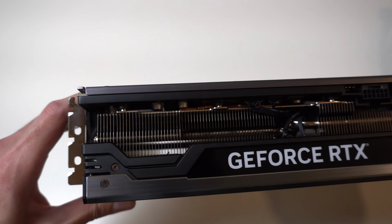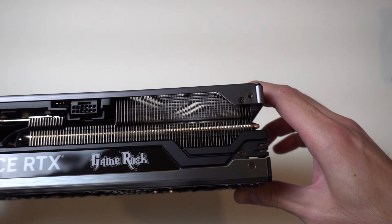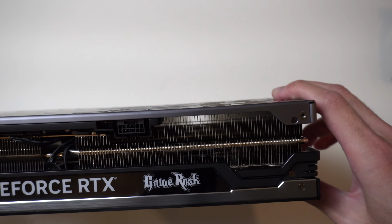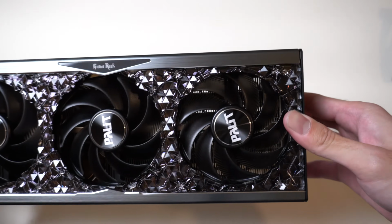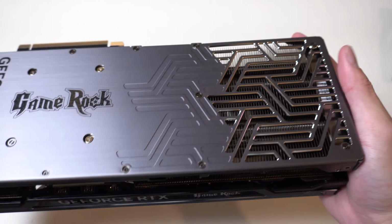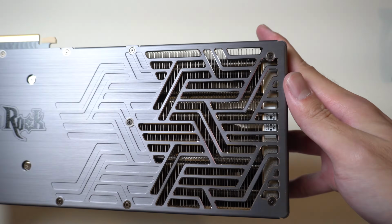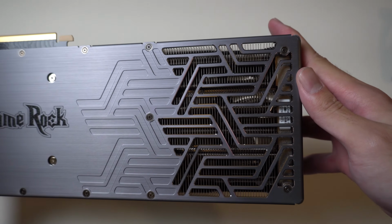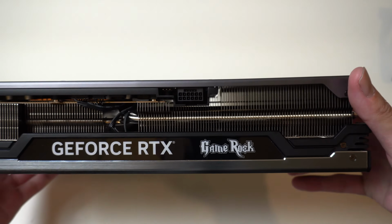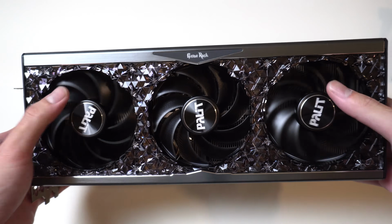And it's just extra thick with all the cooling fins, as you can see over here, which span basically the whole length of the card itself, which makes sense and is a good thing for the RTX 4090, because this thing does draw a lot of power at 450 watts. So you'd want all the cooling you can get with triple fans and a really huge heatsink that, with a short PCB, can blow through the backplate and straight through cool the heatsink instead of having to crash into the PCB and turn 90 degrees like on typical cards.